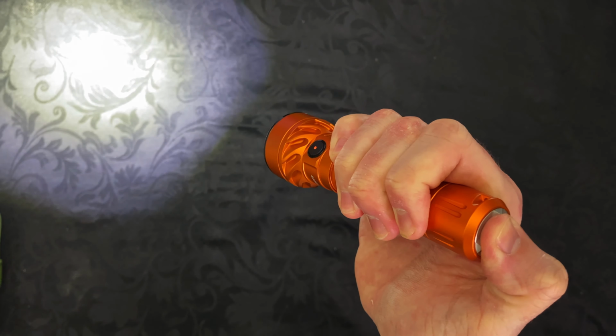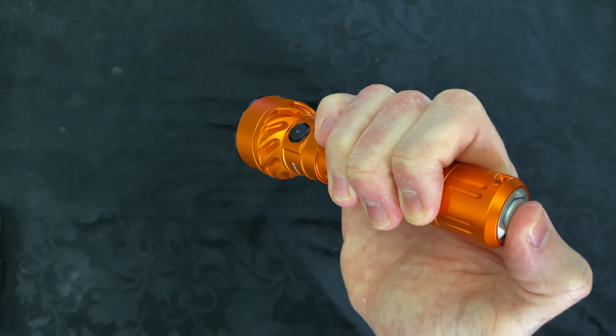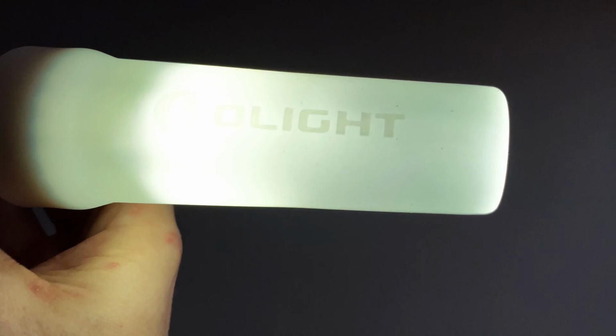The response distance will vary between 3 and 50 centimeters. The sensor may not work if blocked by water, dirt or scratches. When the torch is turned on to high white momentarily, the proximity sensor will not work. The torch should only be set to low mode when using the silicone traffic wand.